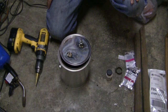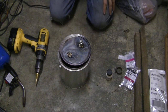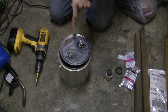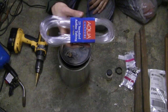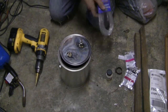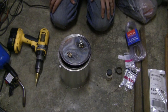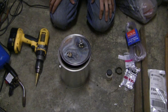That's basically it. The only other thing to do is attach your hose to that fitting. Since we're not dealing with pressure and we're not dealing with really any chemicals, the hose I've selected to connect the smoke generator to the car is aquarium airline tubing. I got 25 feet of this for about three bucks. Use a few feet for this project and keep the rest around for something else useful. At the pressures we're dealing with, you won't even need hose clamps — this type of pressure you could stop with your finger.